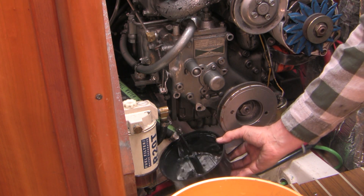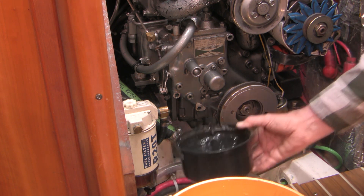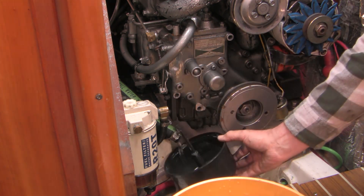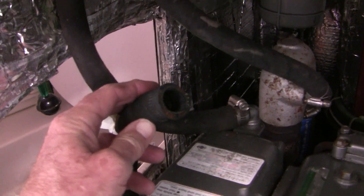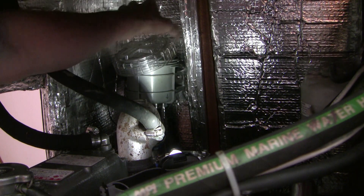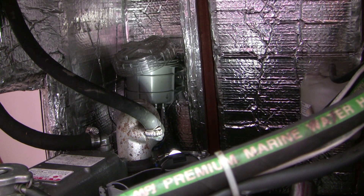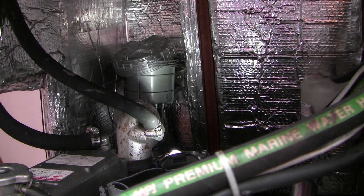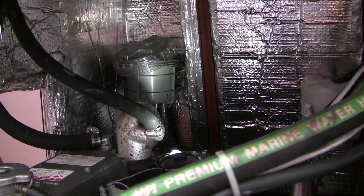Any leak in the hose will not stop until the boat sinks. The quick solution is to raise the free end of the tubing up above the level of the ocean outside, and the leakage instantly stops. Tape it into place and bob's your uncle. A better plan before you take the hose apart is to crack open that strainer and break the siphon, so even a failed seacock will not slowly drip seawater into your bilge after you go back to the workshop with pump in hand.